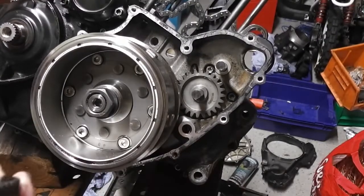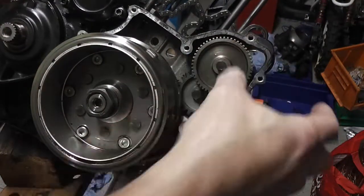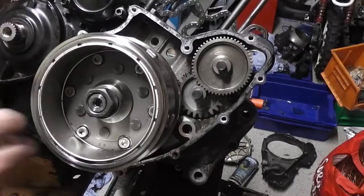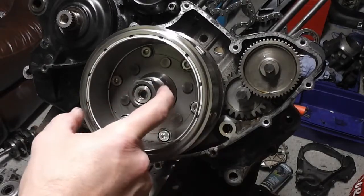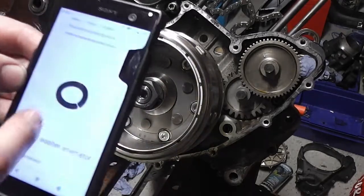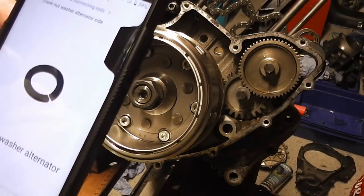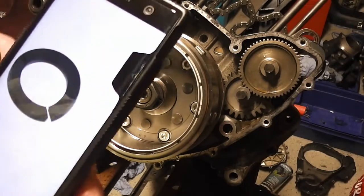We just need to refit these gears then on this side. So there's our starter idle gear, our little spacer goes on, then our washer can go on. Talked about changing the washer, this washer gear, because this has a split in it, and I didn't know whether or not it had to. So I did some research, looked at the diagrams and the drawings of the part, and that washer is supposed to have a split in it there, so we can reuse the one that's on there. So there you go. Okay,